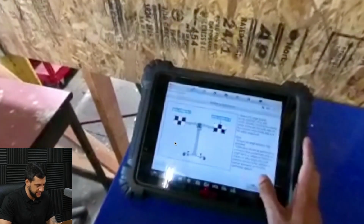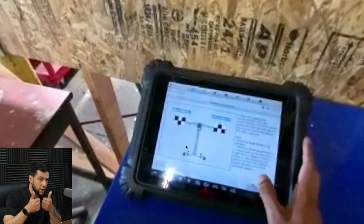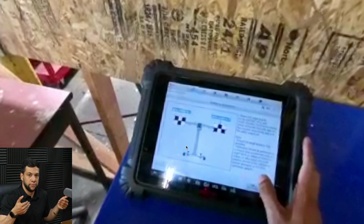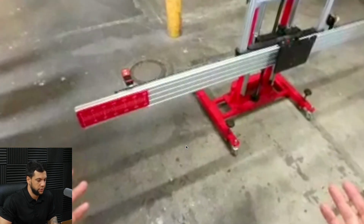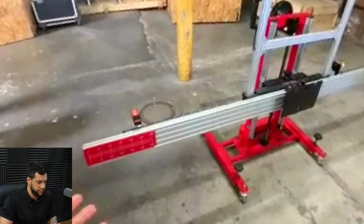So as you guys can see, this is a totally different frame, but even though I'm using another frame, the parameters are right. The calibration will be performed well because what the lane departure wants to know is the targets and the distance from these targets, okay? Everything else is going to be the same. Okay, let me advance this part. I'm just explaining this to you, showing the frame that I have. And here, targets placed. Okay.